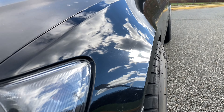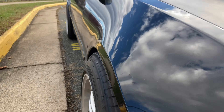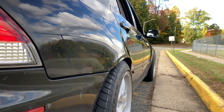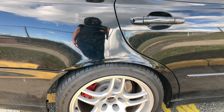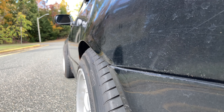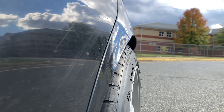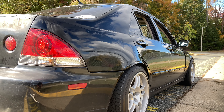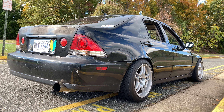Here's a close-up on the back. The front I didn't really have to do much — I'm probably going to add a little camber, it does need to flare out a bit, but it's never rubbed before so I'm not worried. The front's a little better now, definitely not hitting there. I did a couple hard turns and there's definitely no rubbing — she's good. I may even be able to lower it now, which is great. I can definitely go lower in the back. The only other test is having people in the back and finding some bumps. Take your time, do it right, and try not to break the tool — thanks for watching!